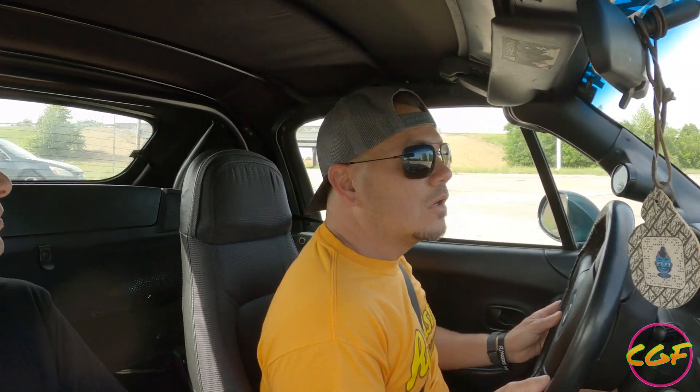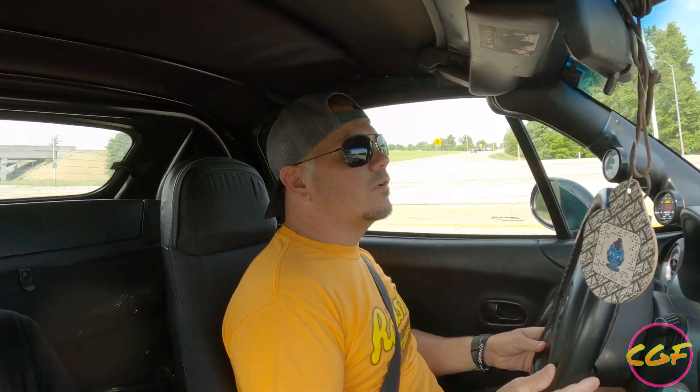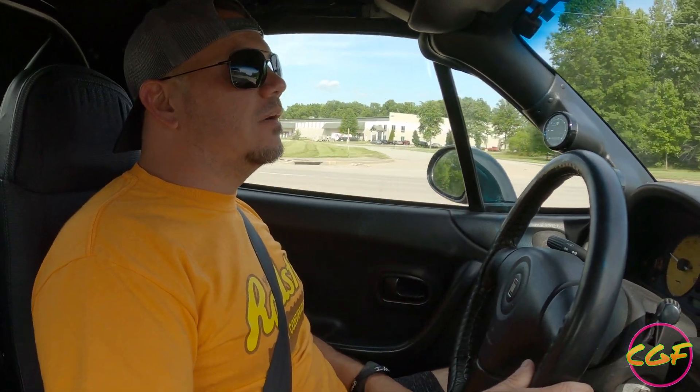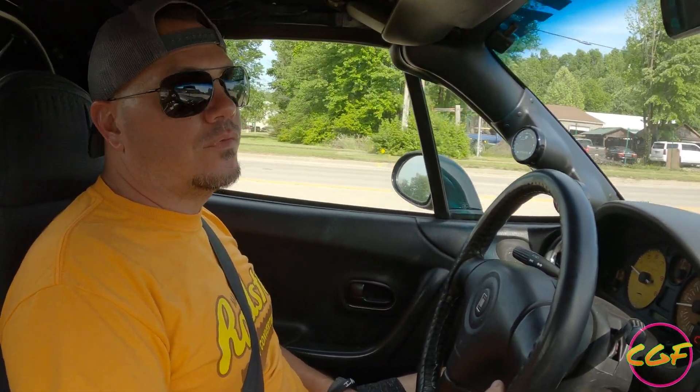The big difference I can tell is when he's in 6th gear, there's basically no acceleration on the highway at all. You don't have as much gear, which is what we did — but you do gain drivability. This car is much easier to drive. If you're putting along on the expressway, you're not building much boost — so you're back to like 100 horsepower trying to pass in 6th gear at 3,000 RPM. Whereas before I had the motor at 4 grand, getting into 5 pounds of boost; now I'm getting into 10 all the time to utilize all the power.